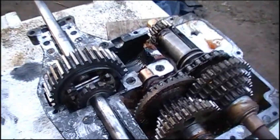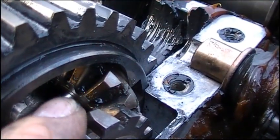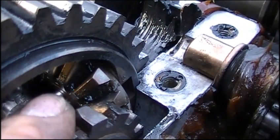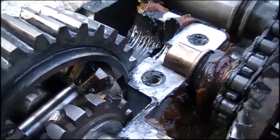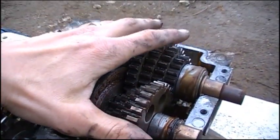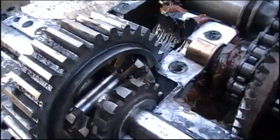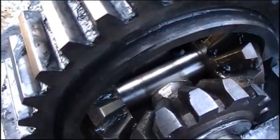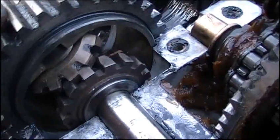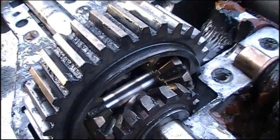So here's the moment of truth. Where we're welding is right there — right against that smooth machined surface right against the spider gear, just as we did the axle shafts. The only difference is right now we have to weld this while it's in the transfer box. So either move these gears or cover them with those old damp jeans, which is what I'm going to do for simplicity. We're going to do a couple of tack welds on each side — one there and one over there — then turn this whole thing over and do a tack weld on each side of that too. We're going to do really hot fat tack welds; we're not going to baby these things.